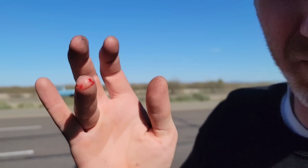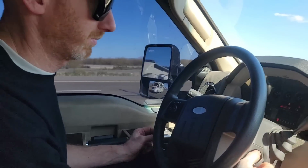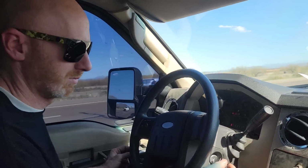I found the stabby hose. Hey, nice. The worst part about it is now I have to get a new glove. Should we test it out? Yeah, I guess. A lot better. The bracket was basically, when you'd hit the throttle, it would tweak this way or this way, and the cable was pulling on it, but it's not actuating the other rod that goes back to the P-pump, so it's just taking up all the slop, and it's probably been that way for a while. So I'm guessing the truck probably didn't have actual full throttle for the last, I don't know how many miles. I bet it's gonna drive like a dream now, like a brand new truck. Let's go.